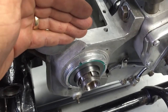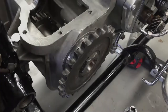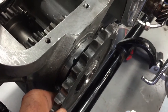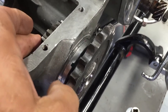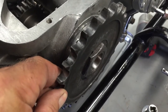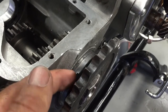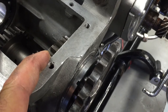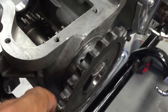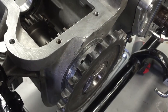You're going to be setting up the main shaft end clearance, so make sure everything's captured and locked in here nice and tight. When you're doing things, always double-check your work. Here's a classic case where the sprocket goes on, it's tight, and you can see how much wobble there is. You have a look at the sprocket driver gear and that sprocket is on tight — so it's either the collar down here that may not be wide enough. This is somebody else's reproduction gear — it could be manufactured a little bit off. Always double-check your work at every single step.